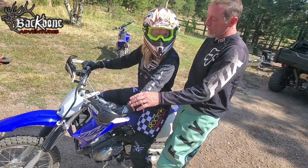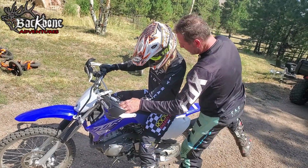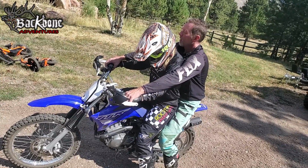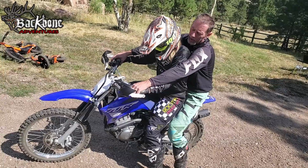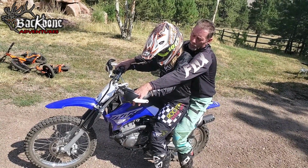Okay. So now what we're going to do is I'm going to sit on the back with you, okay? And I'm going to help you feel this clutch. That's the most important thing, is you understand how it feels. So I got your brakes and nothing's going to happen to it. I want you to let out on that clutch a little bit. Just a little. See how the bike is starting to want to move?